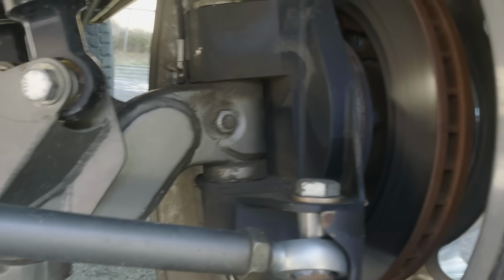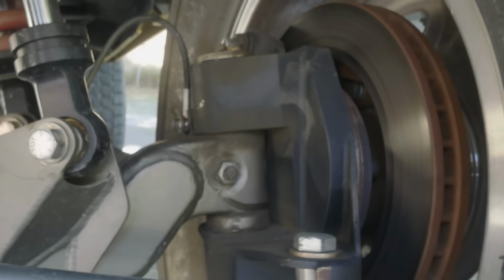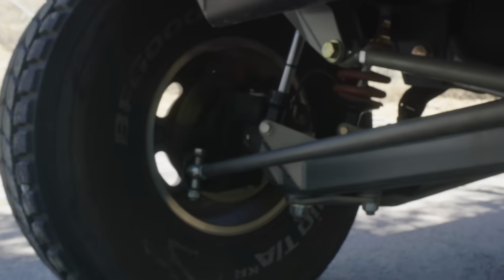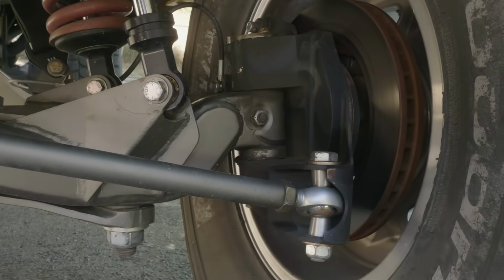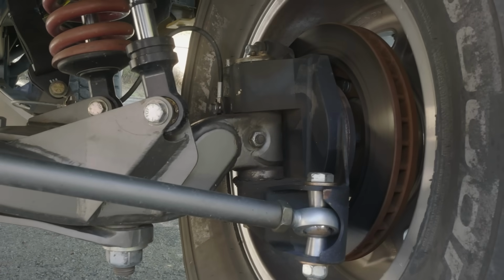And then he says, well, I don't really like these van spindles that you have, these 1-ton van spindles. So we drew a set of spindles up, and we had a machine shop make those spindles out of chromoly. Danny drew a picture of it, and we took it to the guy, and he made it into the CAD drawing, and the machine cut them out. And they're 1.25" kingpins up, like a C60 Chevy truck, like a medium-sized truck.